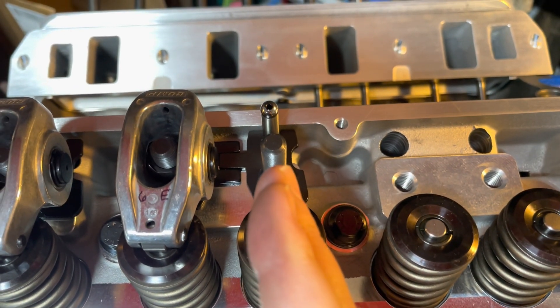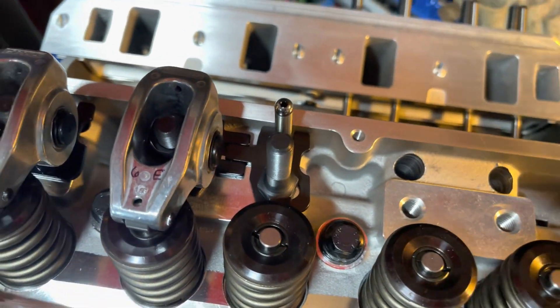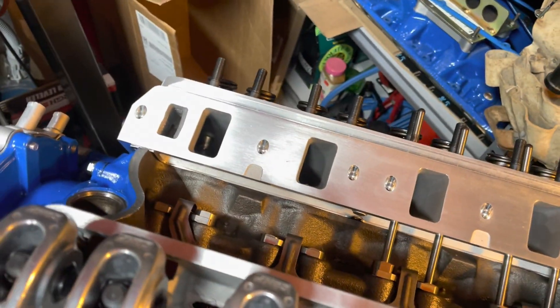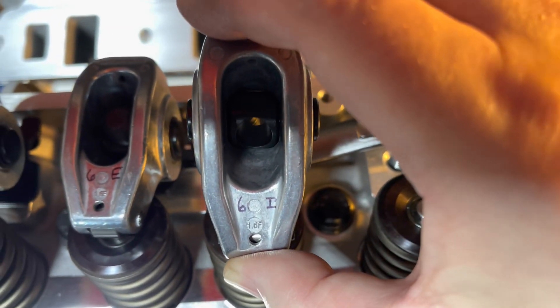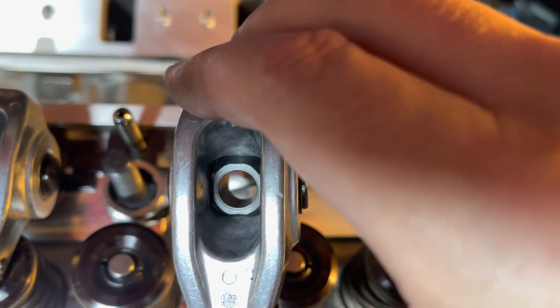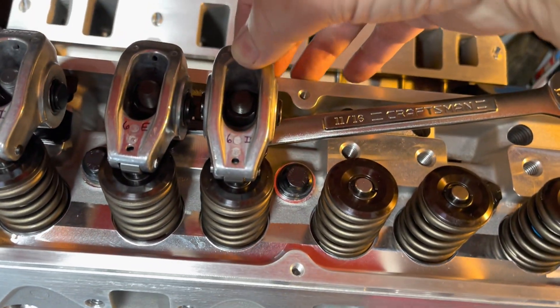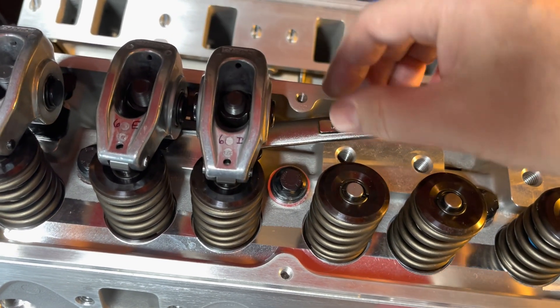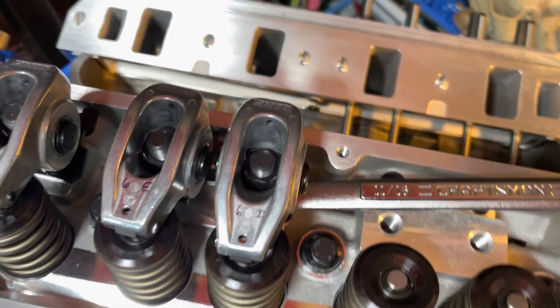I notice the stud, as you're torquing it, leans to one side or the other while it's pulling down tight. So you think you got it lined up and you tighten it and it's not where you left it. I just work my way across, on the box end here so I can snug it and loosen it. I'm keeping my rocker arms — this is number six intake — and I have to make sure the rocker is in there; that one was upside down. I just push down on the back and wiggle it back and forth until I get it centered, then loosen, tighten, take it back off, put my torque wrench on there because you can't torque it with a rocker arm in place. So it's a lot of trial and error, but I'm getting there.